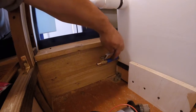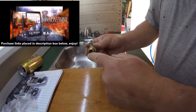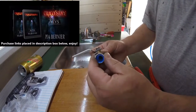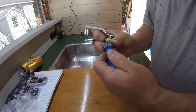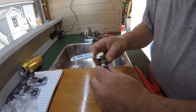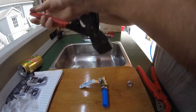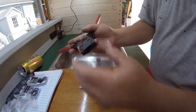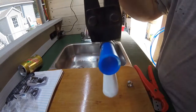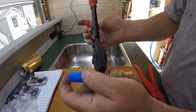The next thing I will need to do is secure this to these pieces right here. I'm going to show you each step of what I'll be doing underneath to make these connections. This is half-inch to half-inch PEX — I have this right here. It's going to be slid all the way on. I want this even with the edge when I tighten this. I'm going to slide this right here, set that down, and then use this crimping tool right here. It's going to fit just right inside this, so I really can't mess this up.